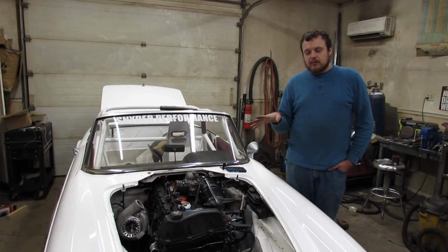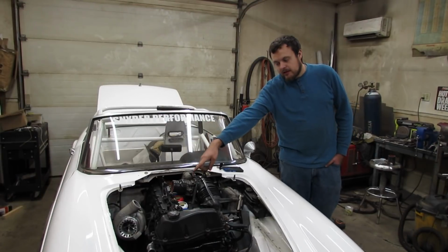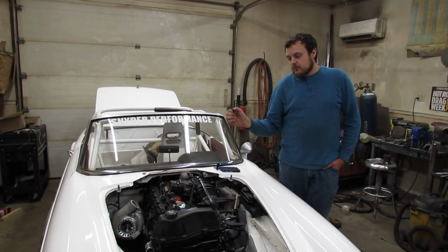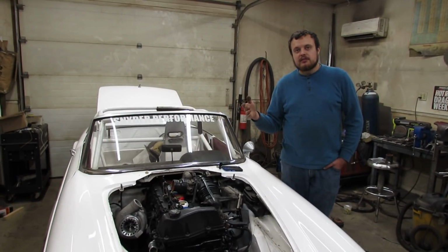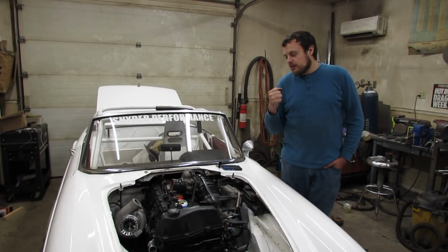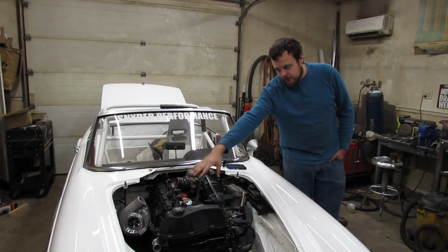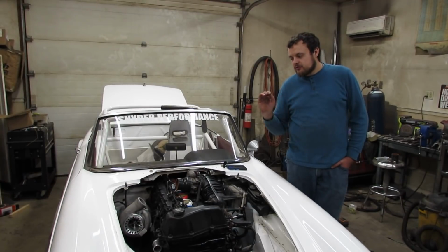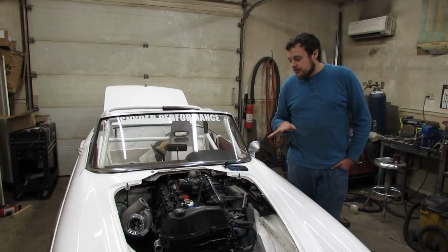The only concern I would have with that is the shock to the system. You're commanding 25 degrees of exhaust cam change, which is going to greatly impact the airflow of the engine and could cause it to kind of hesitate a little bit when it comes in. The mechanical delay of the system, just the oil pressure and all the cavities filling up, may provide a smooth enough transition that it would be okay, but that would be my only concern there.